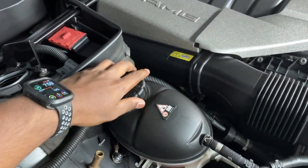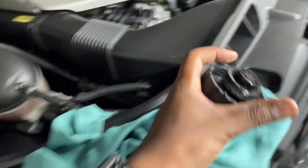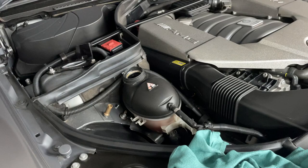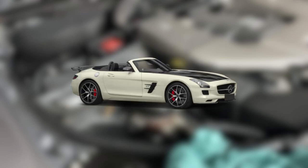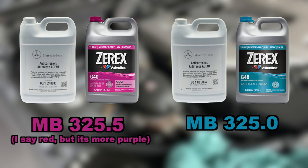When you open your cap you should find blue coolant on the M156, but for whatever reason my car has dealer-installed red coolant. Quick correction: late M156 engines — basically 2014 and onwards C63s — will have red coolant because Mercedes changed the specification. Late 2014–15 W204s and 2014–15 SLSs use 325.5 or 325.6 coolant, which is red. Everything before that uses 325.0 or 325.3 coolant, which is blue. The differences are marginal aside from color. I'm switching back to blue mainly for convenience since all my other cars use the same Zerex G48, which makes things easier. Regardless of which spec you choose, just change it frequently and you won't have a problem.